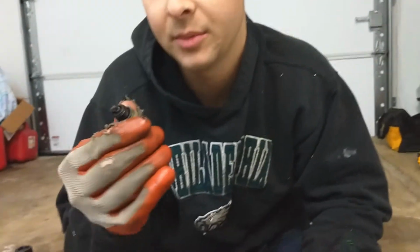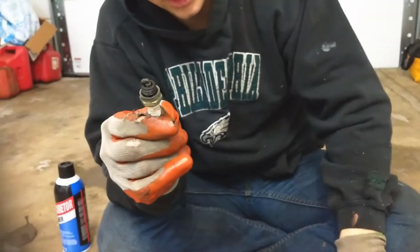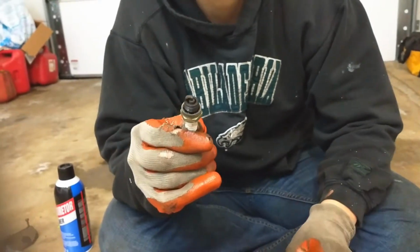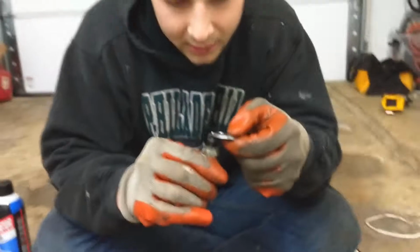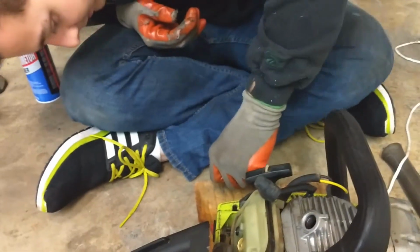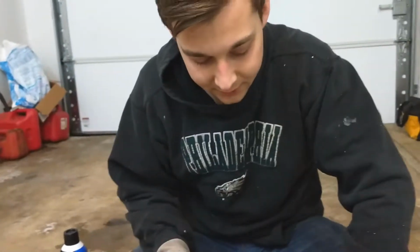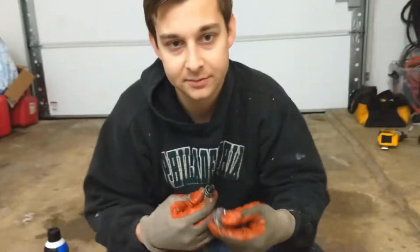Why does this even matter? Well, it's going to basically determine whether the engine's running or not. You need spark for there to be an explosion. So without it being set properly, it could affect the way the engine's running. Like if it's misset, then maybe it doesn't spark correctly, and ultimately the engine just doesn't run. I would say that's almost there again. So freaking close. The engine's built to certain specifications, so you want to stay within those specifications. You see what I'm saying there?